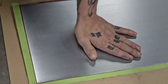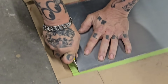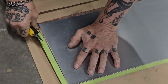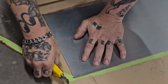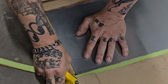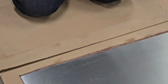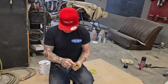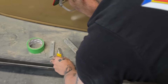We thought we might do it on the Beverly shear, but the Beverly shear generally leaves a stretch mark at the edge of the metal. What I mean by stretch mark is it just bends it a little bit sometimes. My razor blade is probably getting a bit dull. Probably should put another one in, just to make sure. Might have another one here, and I do.